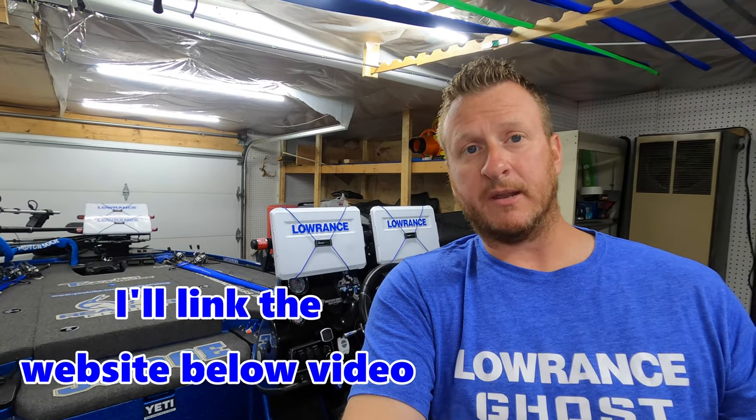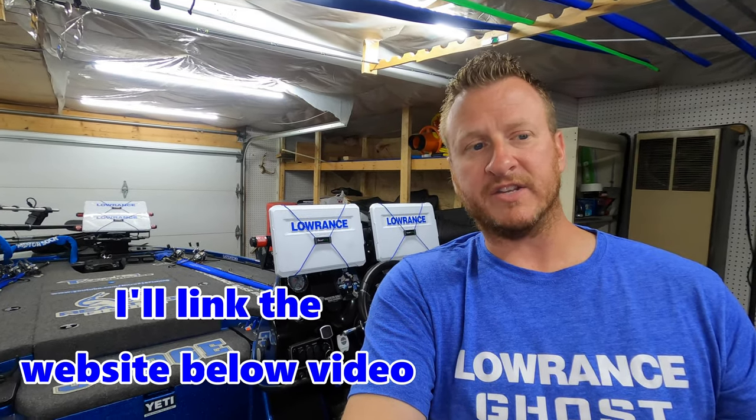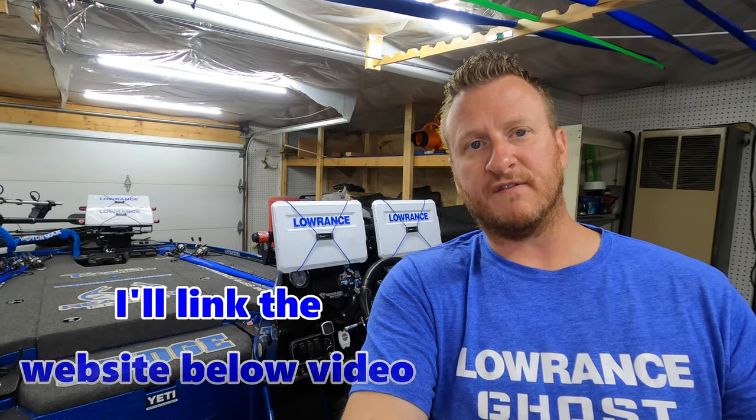One thing I want to mention real quick, guys, is you don't have to duplicate exactly what I'm going to show you as far as wiring size and things like that. The fuses that I'm going to show you, that's something that you're going to have to kind of figure out on your own depending on how many amps you're drawing off the battery and the length of wiring you're going to run. There's a chart out there that you can plug your setup into, how many amps you're going to be drawing, the length of wiring and all that good stuff, and it'll give you a recommendation for the minimum size wiring that you should run. With that being said, you could always go a size bigger and not have to worry. It's not going to hurt anything. You never want to go too small.